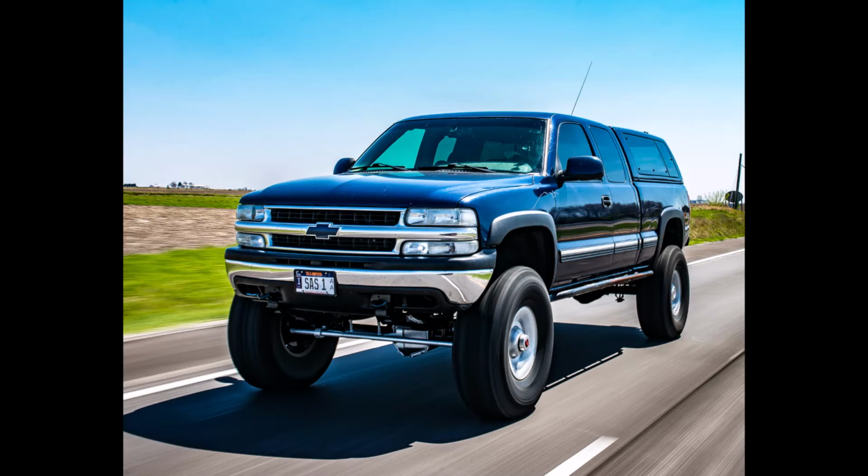And then put the 4L80 in, and I like the 4L80. I like the confidence that I have that it's not going to break. The gearing sucks in first gear. It's a 2.48 to 1. That's what the Cherokee is. Yeah, so it's not great. The doubler was necessary. If I put it in the Eco Box low, which is the same low as the normal 241 or whatever, you need a lot of throttle to crawl up stuff. Double low just goes up at very little drama, very little throttle.